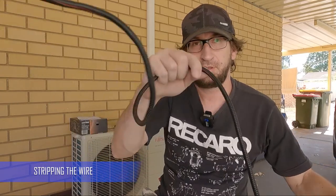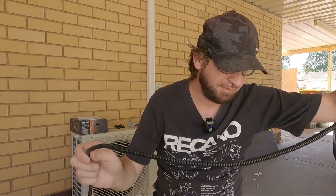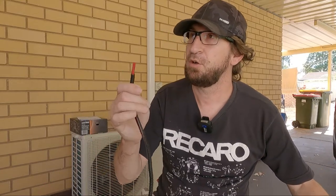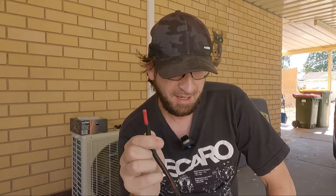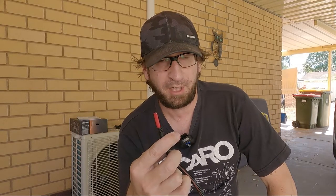Alright, so I've run the split tubing — my hands are very sore right now. I'll need to cut this down so I can add in the extra couple of battery lugs for the fuse holder, but that's the majority done. I always leave a bit of an end open so I can strip it and crimp it. I'll get the crimper set up and we'll look at hooking this end up into the Intervolt unit, then run it around, work out where I'm going to put the fuse holder, and terminate the other end with another battery lug to suit the fuse holder.